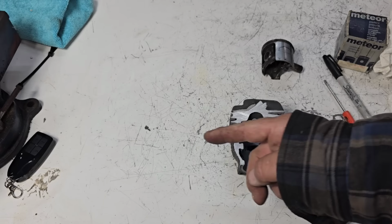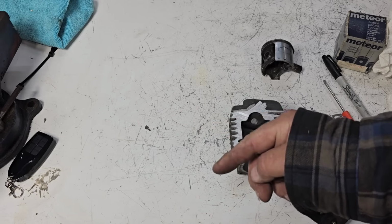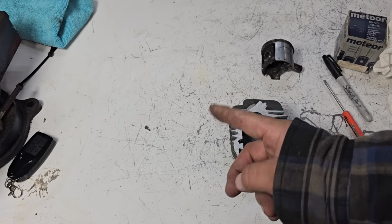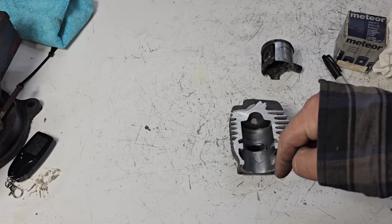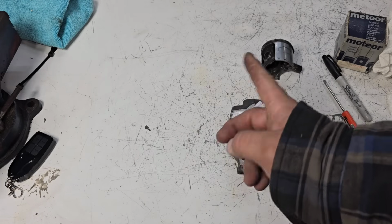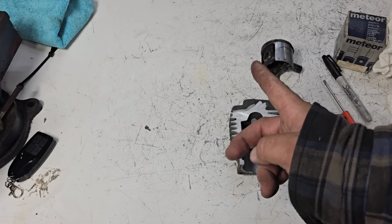At 90 degrees, if the wrist pin is here at 90 degrees, you will get more movement than you will, let's say, up here or down there, because of leverage, right, friends? The farther out it is on the fulcrum, the more movement you're going to get, right?